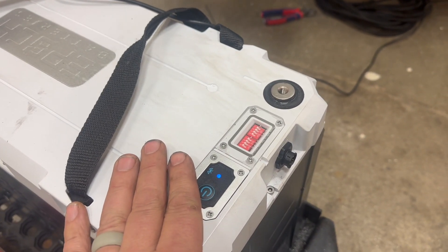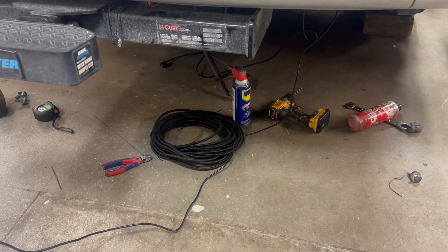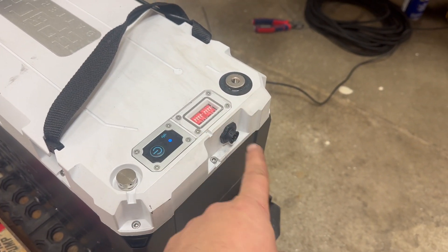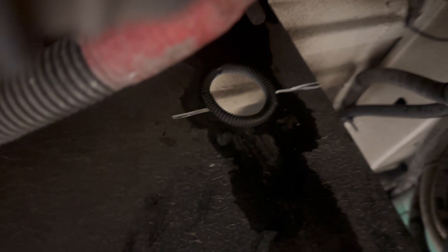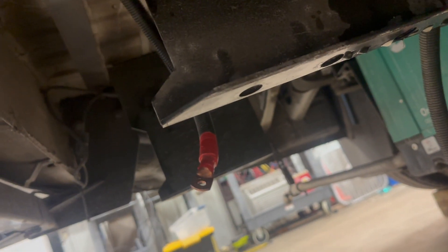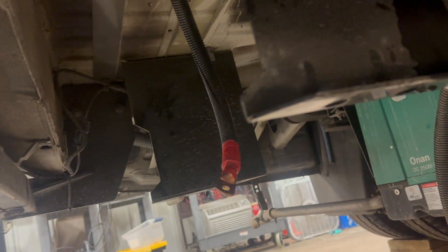The reason it's out and I'm doing so much work in there is that the way the mounting plate is, it comes right up here and I can't get the remote battery switch or the data cables in. So I had to drill out the support there. Got one done, marked it, and then I wrapped the raw edge with some split loom — that works pretty well to keep it protected. Then we just hook up the rest: the main positives there, and negatives down here. Got the other side to cut yet.